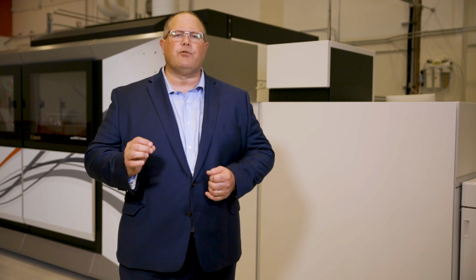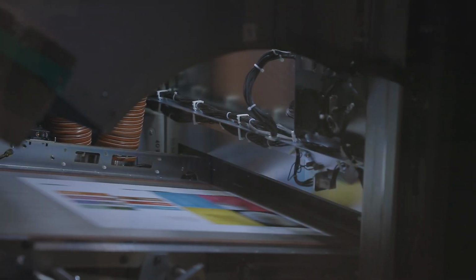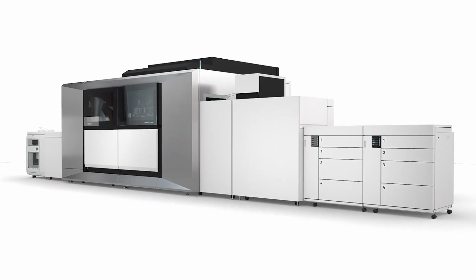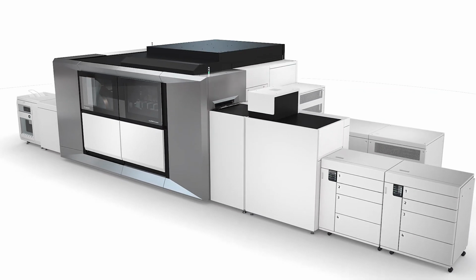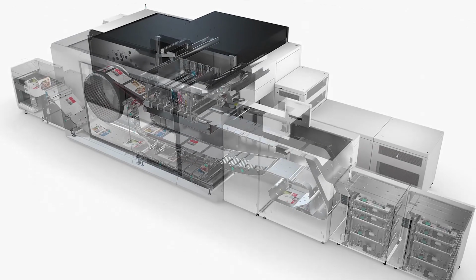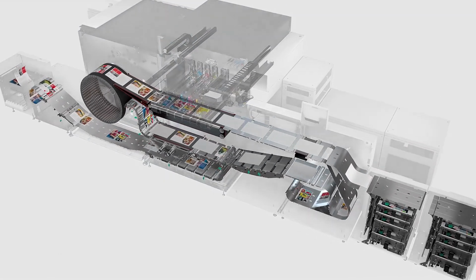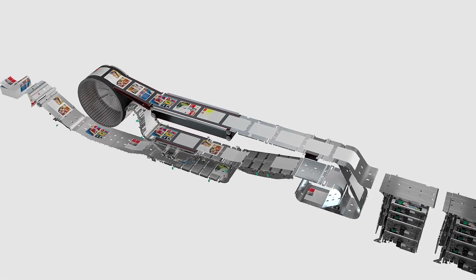The iX series has a sheet monitoring system that keeps track of every single sheet of paper in this engine. It could be up to 37 sheets. Before a sheet even separates from the paper stack of the PIM, an individual state machine, considered its personal traffic controller, is assigned to it. The state machine gives the sheet a unique identifier, applies a precision timetable, and downloads the image for that sheet. 1 image for a simplex, 2 images for a duplex.